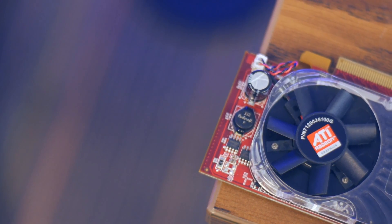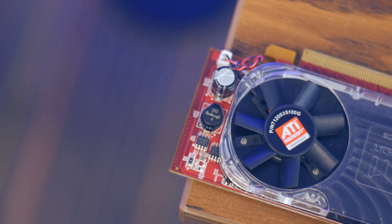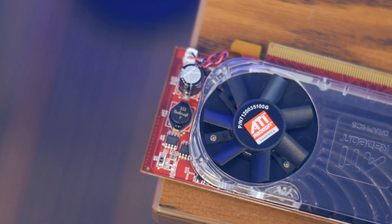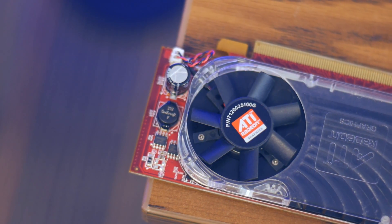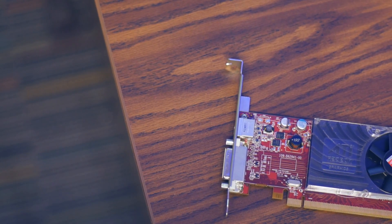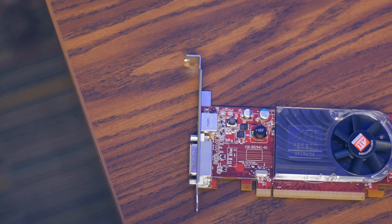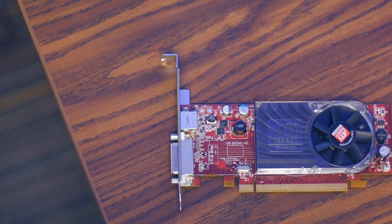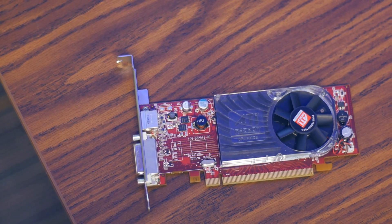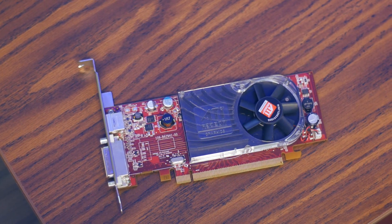The dedicated video card interests me the most out of all of the components chosen. I bought the part for $3.50 and it came with an S-Video and 59-pin digital output signal — two IOs for which I had no cables. Fortunately, I found a DMS-59 converter online for under $10, allowing me to connect it to one of my monitors with a standard DVI cable. I understand the Celeron 450 has integrated graphics, but if I plan on gaming, I won't get anywhere with the integrated GMA 950. With a quick part number search, I found the exact video card model: the Radeon 3450 with 256MB of VRAM, a 600MHz core clock speed, and 1GHz memory speed. It looks like modern gaming may not be in the equation for this computer, but we'll wait and see.